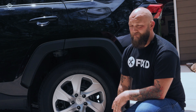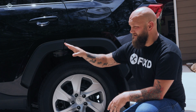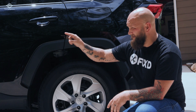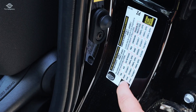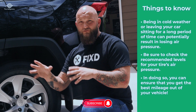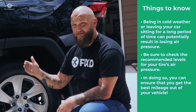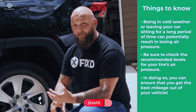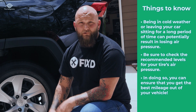The other big one to pay attention to is tire pressure. On every vehicle, the manufacturer has placed a sticker — most of the time on the door sill when you open the front door — showing what the tire pressure should be for front and rear tires. Always check this when it's cold, not after a long road trip. Before you head out, check your tire pressure to make sure it's within spec for best mileage and tire life.